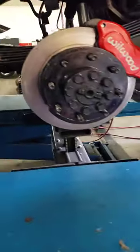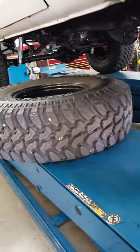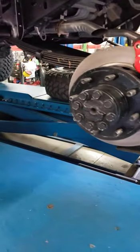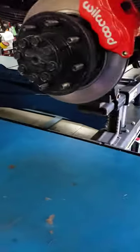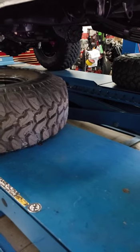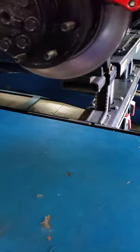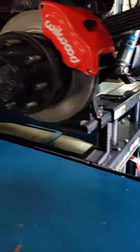Number one is the three-quarter ton or one-ton upgrade. Switching to an eight-lug rear axle, you get rid of so many breakage issues with the half-ton stuff. I ran half-ton stuff most of my life and I know what it can take — it can take a lot. But there's also times when it breaks when it shouldn't. Having a 14-bolt full-floater rear axle is a big plus.